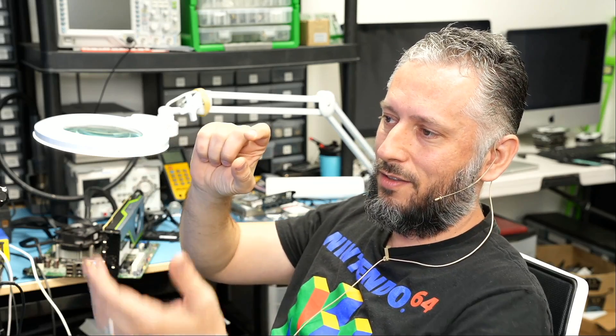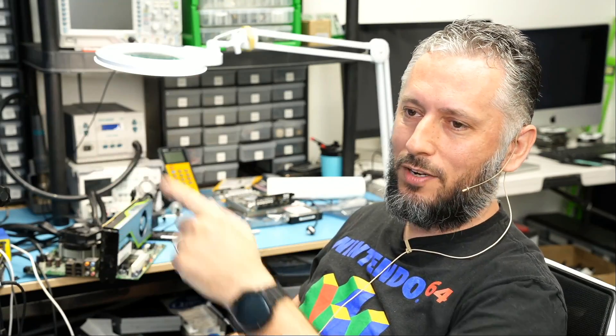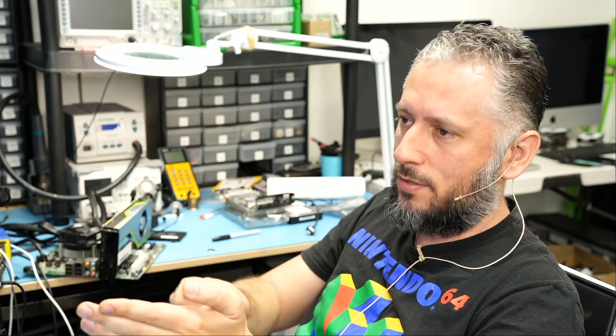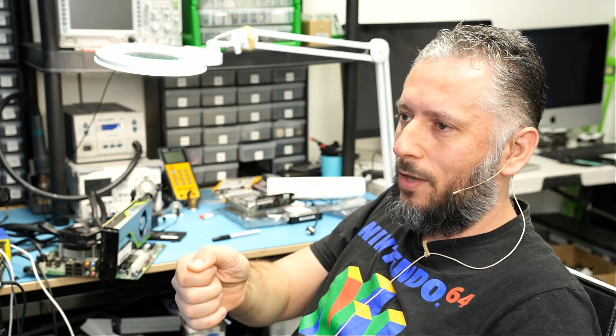You have a clip on the front — the connector connects from the front. You do not have clips from the side. So there's still room for that cable to move. When he was wiggling the black cable left and right, even though that cable was all the way in, he told you that because it's black on black, you're not going to see the gap. But when it came to the yellow connector cable, he just put slight pressure on it and you were able to see the yellow part. And he told you that's a gap he would not worry about pushing back in.